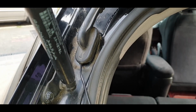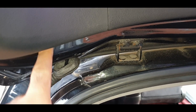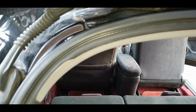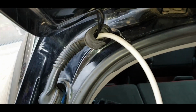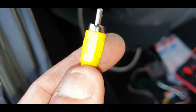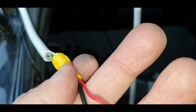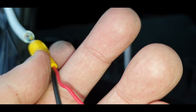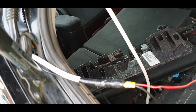Alright, next we need to thread this through that grommet and get it in here. We've got to have somewhere to receive it as well, but first let me see if I could just thread it through the grommet, and that's it. Right, so I've got some thick core cable here, one of those household jobbies. What I'm going to do now is tie this under the cable to that, parallel like that, with some insulation tape, lots of lube, and I'm going to try and pull it through. Wish me luck. Rightio, that's all taped up now. I'm just going to lube it up and pull it through.